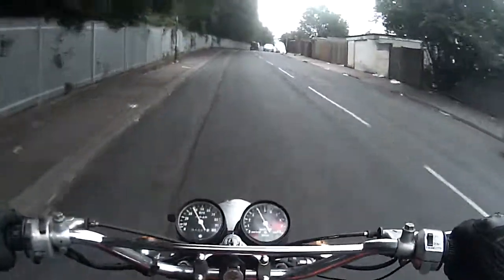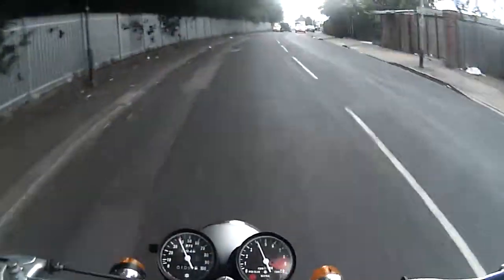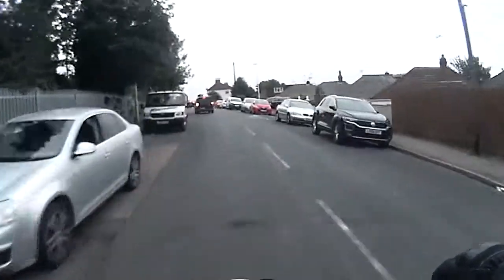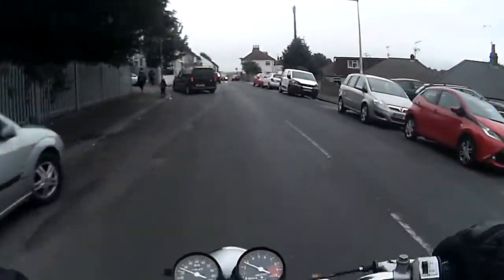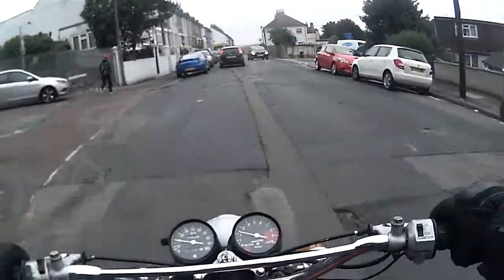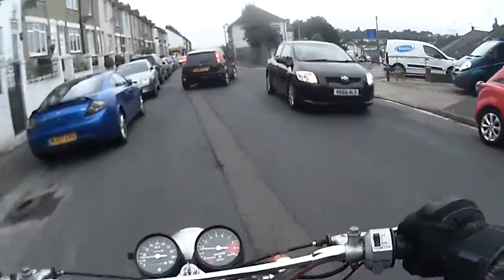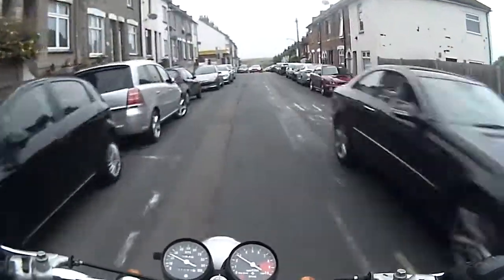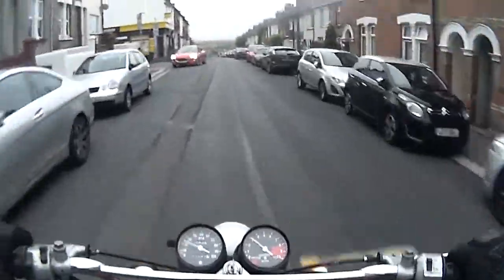Well, that's not bad. Quite a big improvement. But I think we will go down with the needle one more again, just to see if that will improve it even more, because we did have a really good mid-range, which should be important. Getting off the line and stuff.